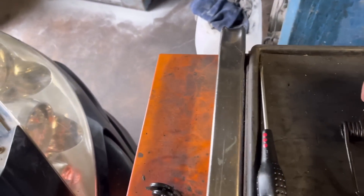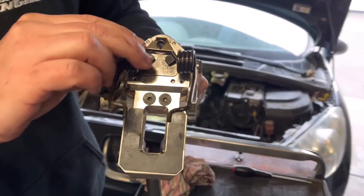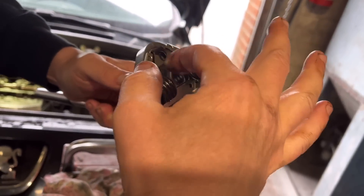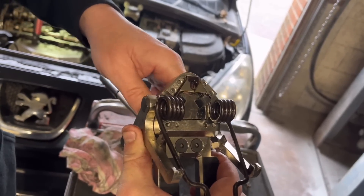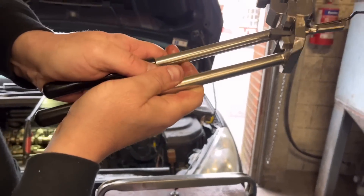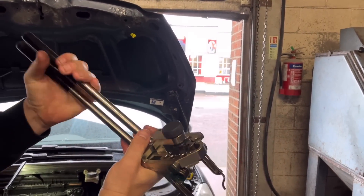What we do is first of all we load this spring into this jig. We have the special tool in the open position, and then we sit that in that location there. We've got a knob at the back here which we wind in and that holds that top bit in position. Once that's clamped up we then pull these prongs over on the tool and shut it until the stop goes on and it holds itself. You can see now the spring is in the correct position — otherwise you'd never get that bolt done up in the top platform.